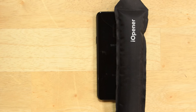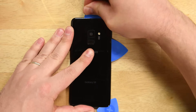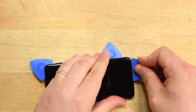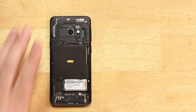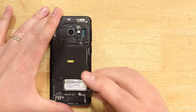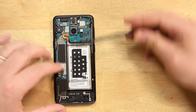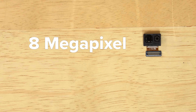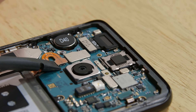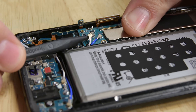From a teardown perspective, there are no surprises here. The opening procedure is exactly the same as it's been for the last couple years. Heat and pry up the rear panel, disconnect the fingerprint sensor cable, and you're in. We've got the same styled mid-frame held in place by a bunch of screws, which come out in two pieces and includes the NFC and wireless charging assembly and the speaker. The 8-megapixel front-facing camera pops right out after being disconnected from the motherboard, and to get the motherboard out, we'll have to disconnect six cables and remove just one screw. Talk about easy.